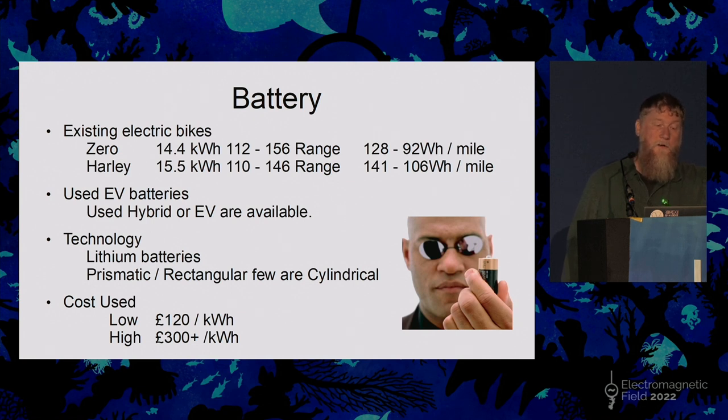You can buy new batteries, but what I'm looking at is what's in the breakers. The hybrids and electric vehicles are in the breakers, and unless you know what you're doing these are quite strange things. There are places still terribly frightened of being electrocuted, which is a potential problem, but most batteries are safe once you cut the main 12-volt supply — all electric vehicles have a 12-volt battery for lights and other systems, and once that's cut, internal contactors isolate the traction battery. So unless those isolators have malfunctioned, you remove the 12-volt battery and the pack is safe to handle.